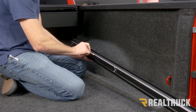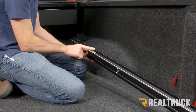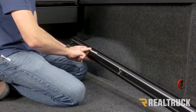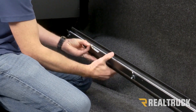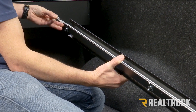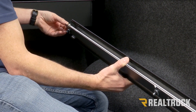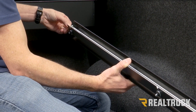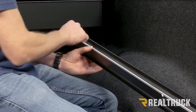The way this installs: make sure the latch stop is oriented properly. The flat side of the latch stop needs to face towards the tailgate, and the angled side needs to face towards the cab. Go all the way up to the front of the rail and slide that latch stop in, then slide it back to where you want the latch position.